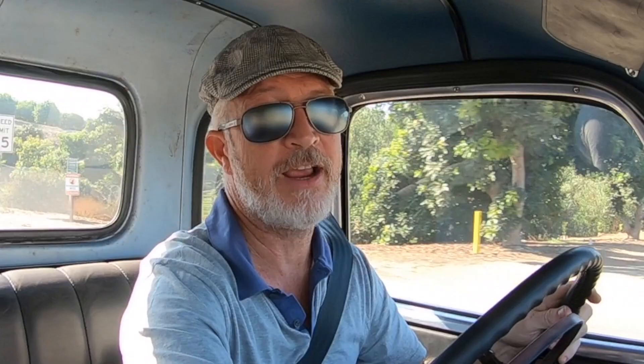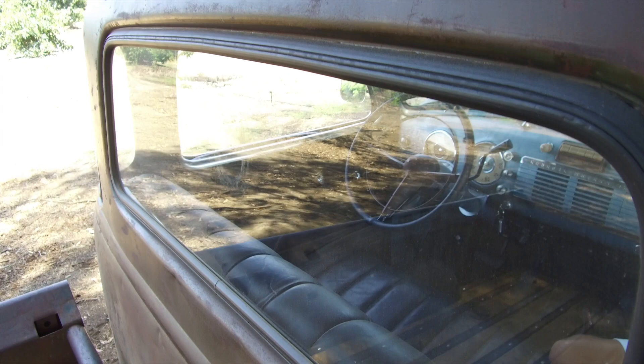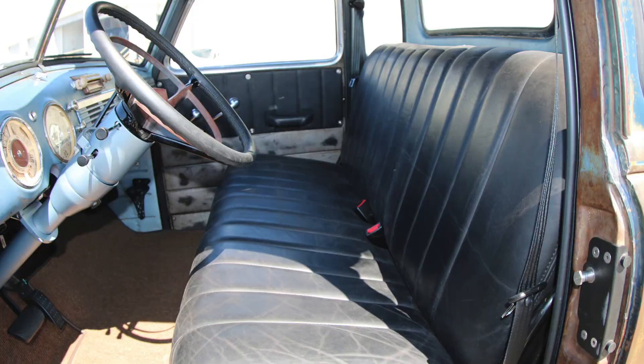The primary knobs activate the Bluetooth and volume control, and the tune knob controls your bass circuit volume. For speakers we used Focal units hidden under dash — just two speakers since it's a small cab — with a subwoofer hidden under the seat. The original seat, when restored the right way, just sucked to sit in. Even with the tilt column, enhanced ergonomics, and a reduced-diameter steering wheel, it was practically a rigid 90 degrees at my head. So we tore it down to the raw frame and replaced all the springs with Tempur-Pedic foam, which allowed us to be thinner but still have the cushioning we needed.